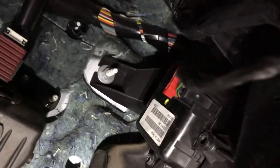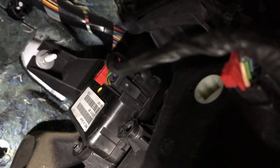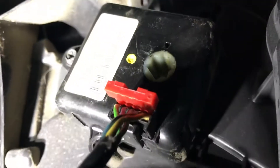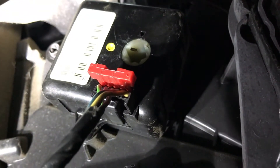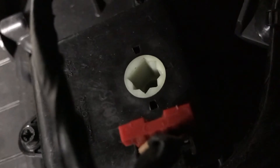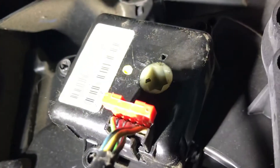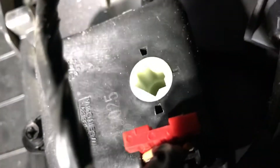So again, there's the gas pedal, blend door, blend door, and blend door. These two blend doors actually control both heat and cold, which is kind of bizarre. I'm turning it to cold right now — this one moves, and after that one moves, then this one moves. Back to hot: that one moves and then this one moves.